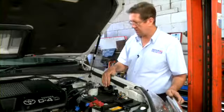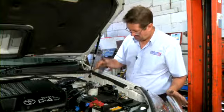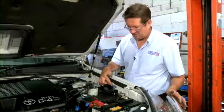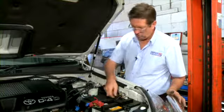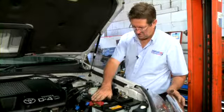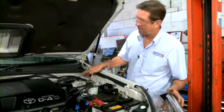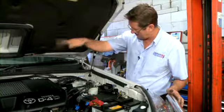In summary of the installation now, everything is completed. We've mounted the module on the side of the Prado here. We've earthed it under one of the locating screws. We've run a wire to the positive terminal of the battery. It's hooked up there. Our front two capacitive couplings are on the firewall here and on the left-hand guard on the Prado on the other side.